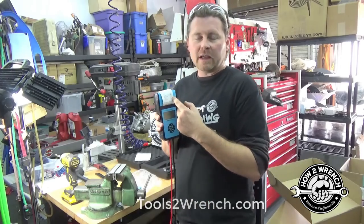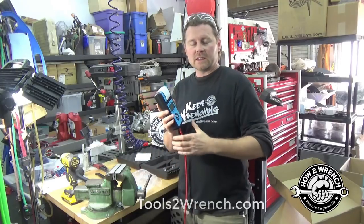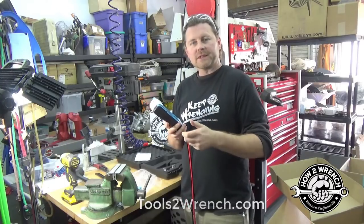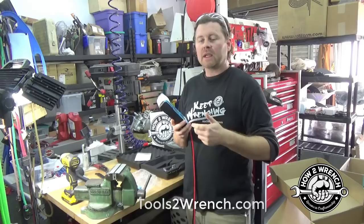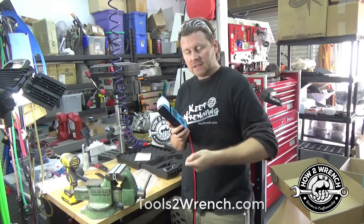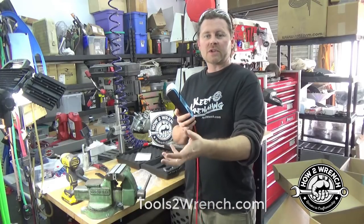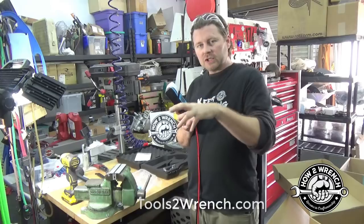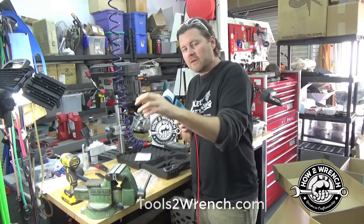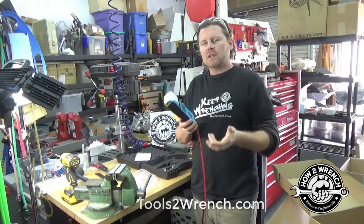But if a battery is rated at 500 amps and you're only getting 400 amps out of it, that tells you the battery is going towards its end of life. You could have a weak battery where the vehicle still starts and the charging system seems to work, but that weak battery is taxing everything — the starter cable, the starter, the charging system. We want a battery that supplies and accepts voltage easily. As batteries start to fail, the charging system has to work harder to fill them, which taxes the starting system too.